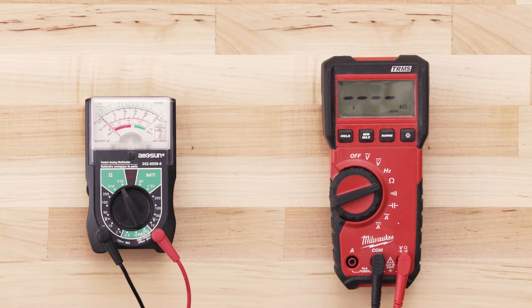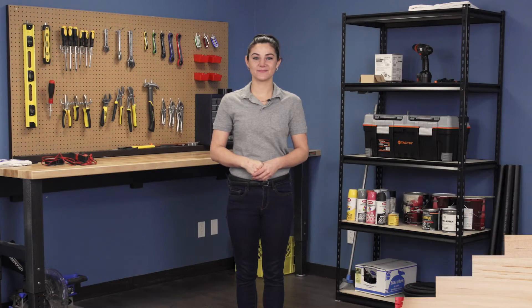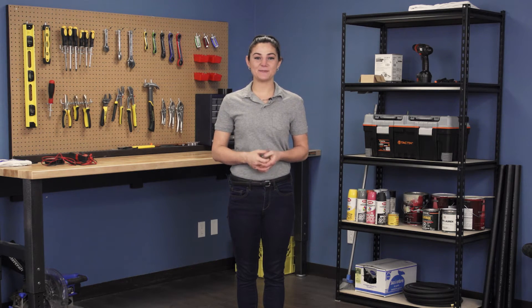If there is no reading on the multimeter or very little change, then there is no continuity and you will have to replace the element. If you found this video useful, hit like. To keep up to date on Repair and Replace, please subscribe. And for the widest selection of parts, low prices and same day shipping, explore our website below. Thanks for watching.